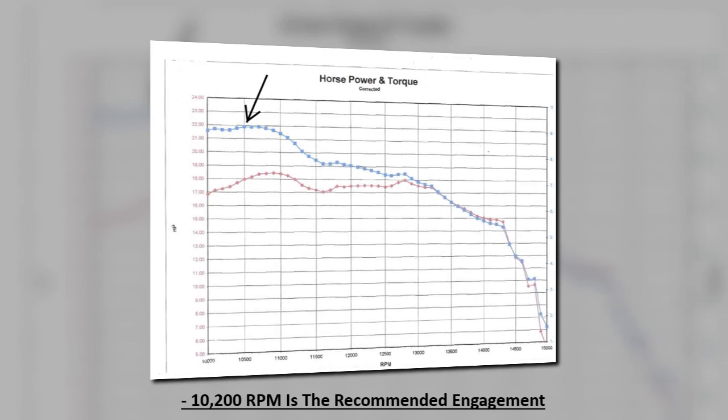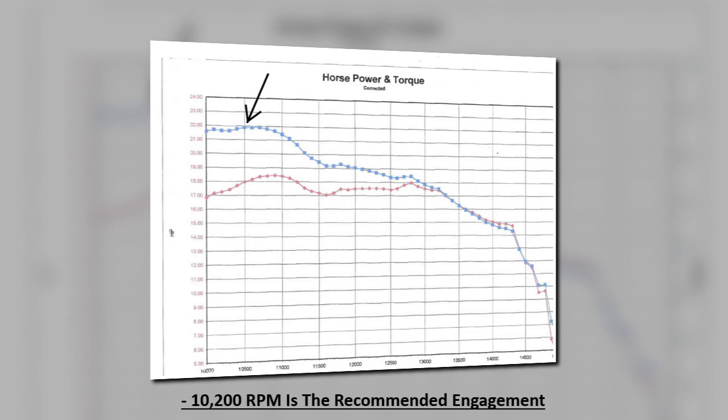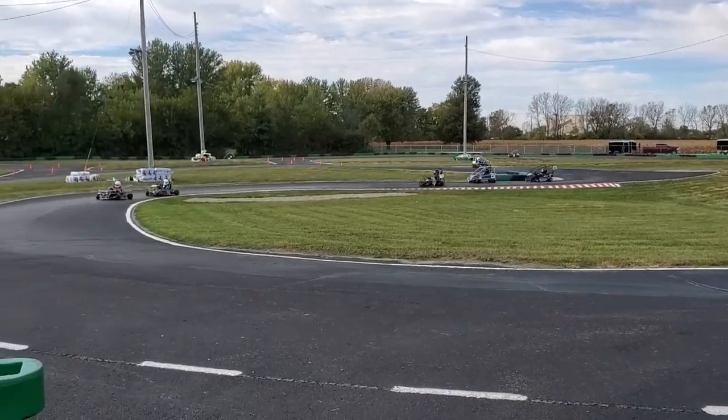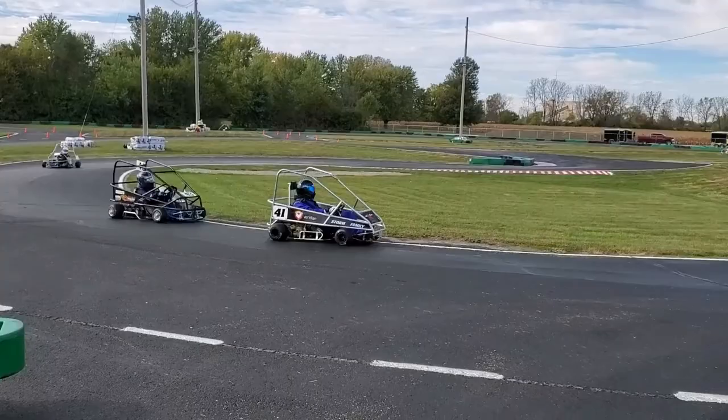Don't forget that when you're holding the brake and throttle wide open, the clutch is getting hot. 2 or 3 seconds is about all you need, and the clutch won't overheat too quickly. Once you have the setting within range, head out on the track, check it there, come back in, and adjust as needed.